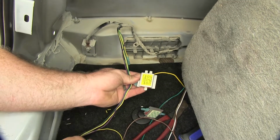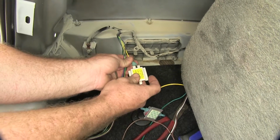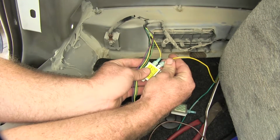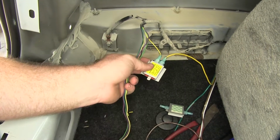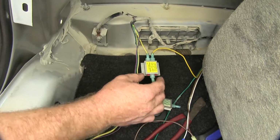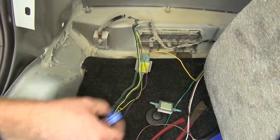That out is going to be going towards the connector for our tail light, and so the in is going to be getting the signal coming from the car, and then also the signal coming from the motorhome. So you want to put those on there. Then the other end we'll put on that outside so that we can make sure that both of those signals go through to the out and make it out to this connector.